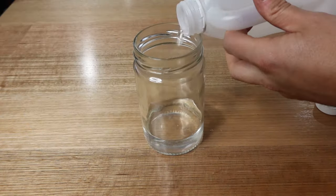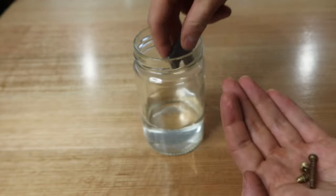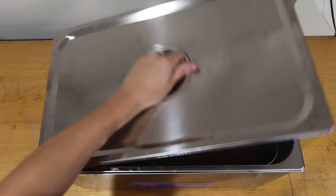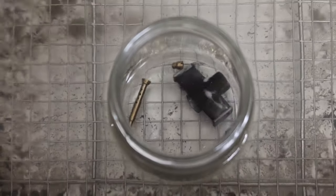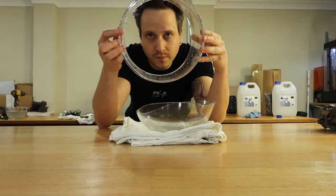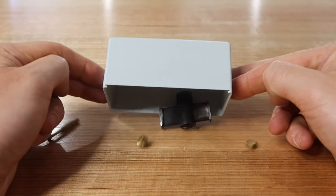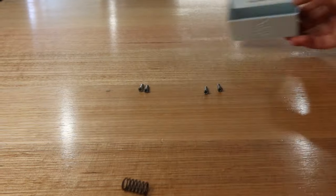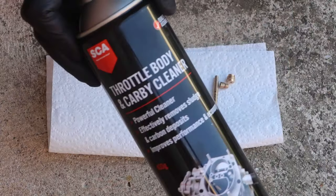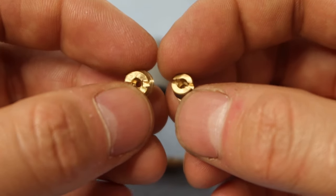I'm still using my 50-50-ish solution of water and vinegar for cleaning in the ultrasonic. While it does seem to do a decent job with general grime, it doesn't seem to do quite enough for carbon buildup. I've got a couple more solutions to try, but for now I'll just use these, get them cleaned up as best I can, try not to break any more glass containers, and then tidy up the rest with some carby cleaner from the can. I'm a little bit risk-averse and I don't want to leave the aluminium in with the vinegar for too long, so it's possible that with a little more time they come out cleaner, but I don't think the risk-to-reward ratio is there for me. After a little love, they're looking better than ever and ready to go back together.